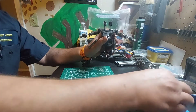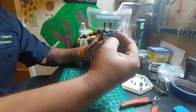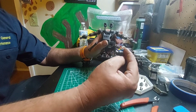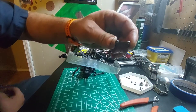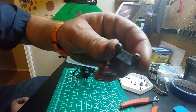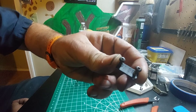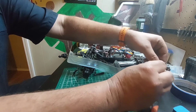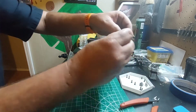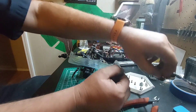Set that to the side. You always want to try to remember how that pill is positioned. Right now it shows it's one millimeter down — you can see it says one millimeter — and the arrow is pointing down. That's how I want to remember to put it back into this anti-squat bar.